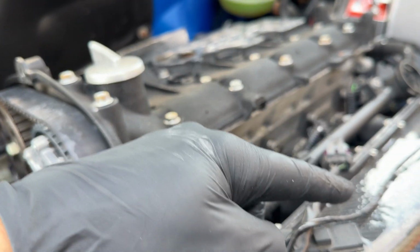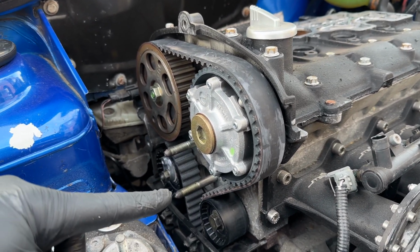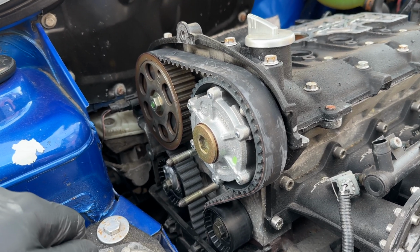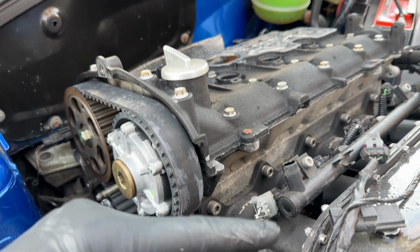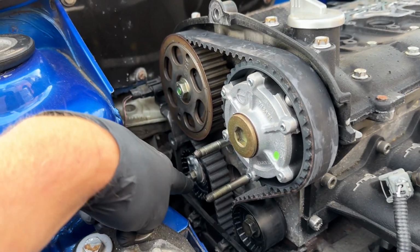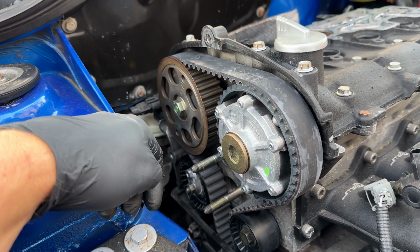And what you need to do is remove the crank pin, the camshaft horseshoe tool, and then using an 18mm socket, don't go backwards, go clockwise and rotate it through 6 revolutions, and then put the pin back in, put the horseshoe back in, and providing they go straight in without being forced, and the timing marker lines on the belt tensioner, you're done.